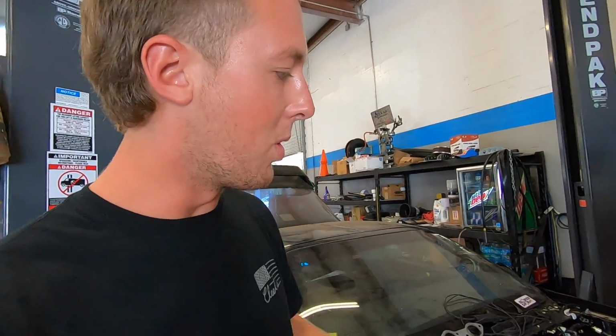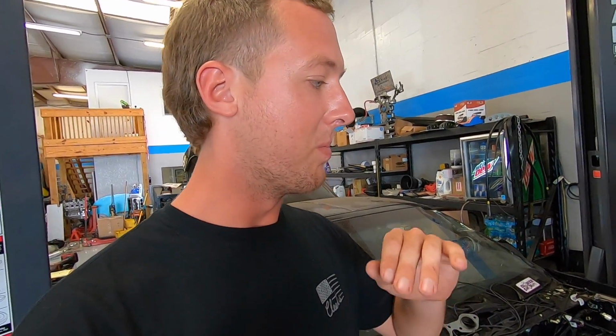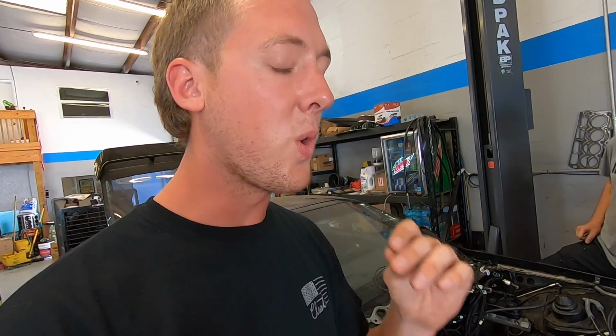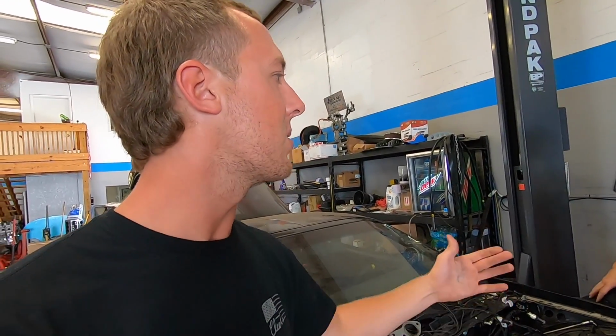So what we're doing, and this is what all of the Australians do, is we're putting Toast on methanol. So that means no more Ignite E90 for old Toast. We're going straight over to 100% methanol, which we've never had a car that runs on before. But the benefits of methanol are it runs incredibly cool. Literally, some of these guys have problems getting their cars hot enough to even race or do burnouts.